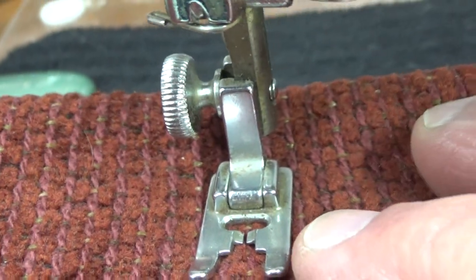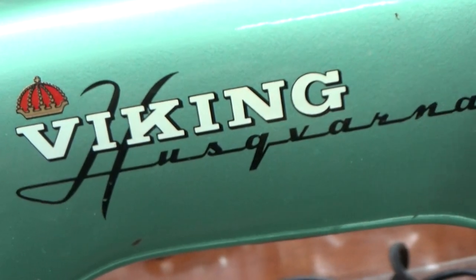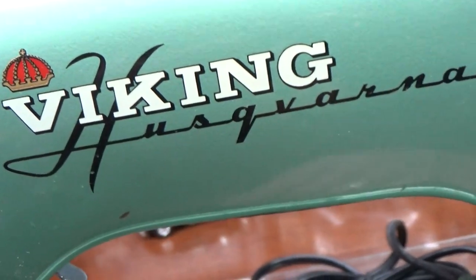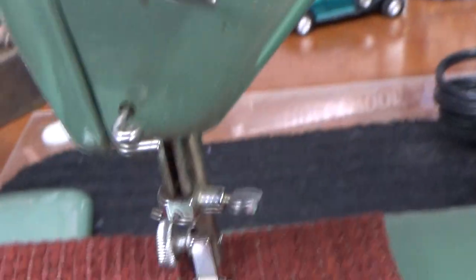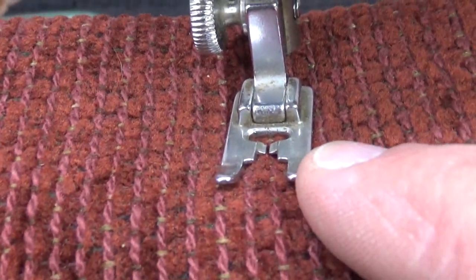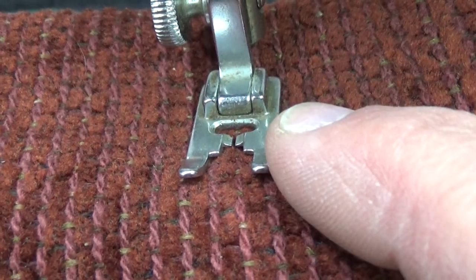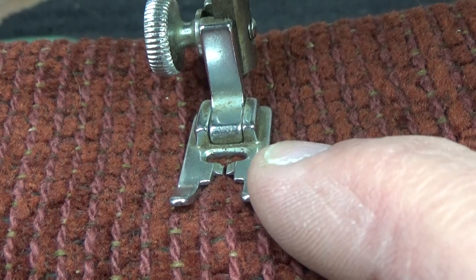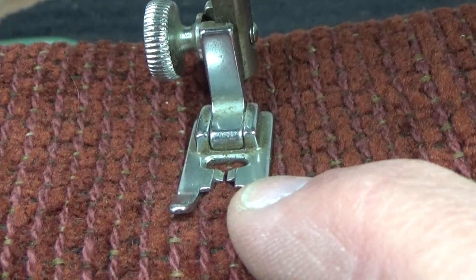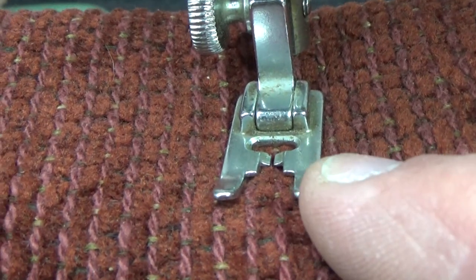So the simple rule is, if you've got a Swedish Beauty like this, never, ever operate it unless there's a cam in the rear of the machine. Don't do it, because you're very likely to roll the dice and you're either going to strike the presser foot, which will cause scarring to it, the throat plate opening, which will cause scarring and cause that metal, which is real thin gauge, to actually get barbed and then start snagging thread and all kinds of other disastrous things.